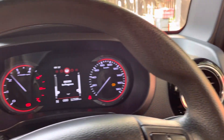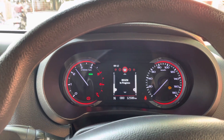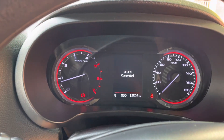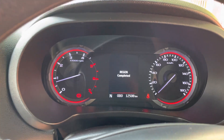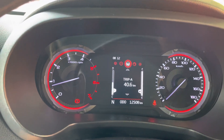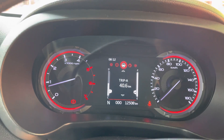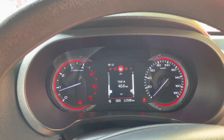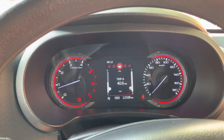The regeneration is now complete — it's hardly been five minutes and the RPM is back down to 750, which is a normal idle RPM for the diesel Thar. You can see that the regeneration is a very simple process.